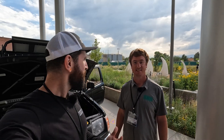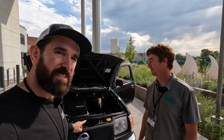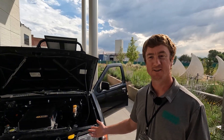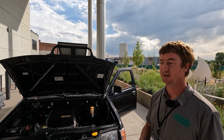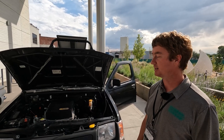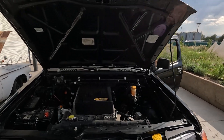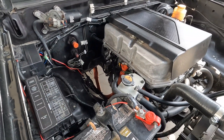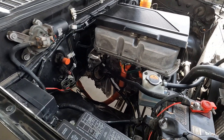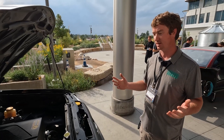What's up everyone? I'm here with Jimmy from EVSwap — my buddy who's done the Land Cruiser and countless other cars. I haven't seen this Frontier in person, so Jimmy's going to take us through it. This is a '98 Nissan Frontier. The customer Dave bought it back in 2009 with the intent of doing an EV conversion, but never got around to it until he met Jimmy. They used a Nissan Leaf powertrain and battery from a 2019 Leaf. The motor stack is under the hood: charger on top, inverter in the middle, motor at the bottom — the full Leaf stack — at 150 horsepower, 110 kilowatts.